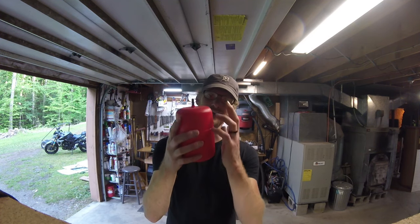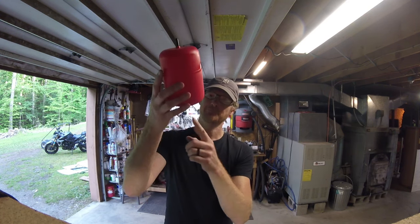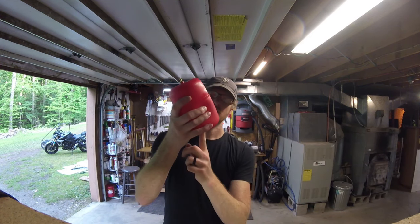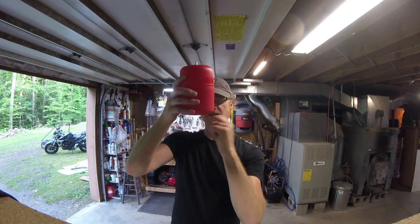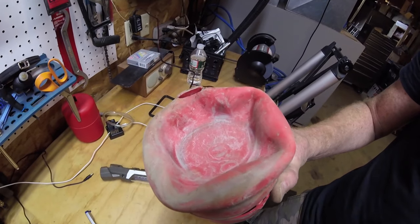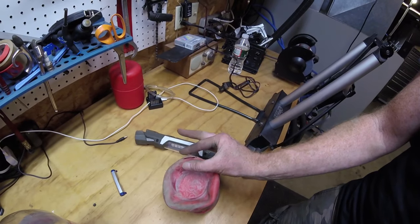Well, that allowed this bag to ooze down low. Like this, it actually folded up. This got pushed up. If you take the air out, this got pushed up. This slowly moved down around the base of the van. There's a little cup at the bottom that it sits on. Everything moved down, kind of got pinched between that cup and the coil spring. And there was a big cut along the airbag, and it was leaking air as well.